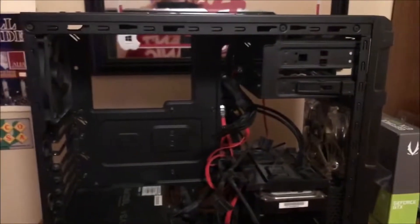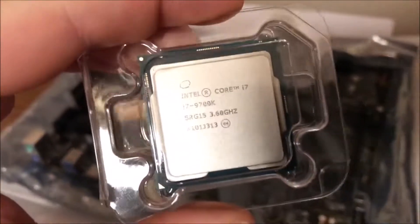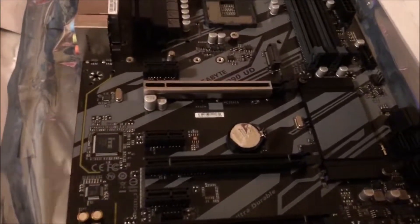It's still coming off — we're going to set the case off to the side for a moment. Here's the new board: Gigabyte Z390 Ultra Durable. Got it out on the anti-static bag — nice looking board. Going to grab the CPU, Core i7 9700K. That's 3.6 to 4.9 GHz, it's gonna be screaming. You see that little arrow right there on the edge? That's where we indicate how to install it. The board is kind of like a highway — everything's got its own place.